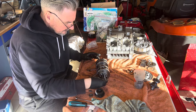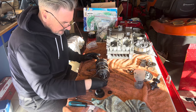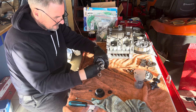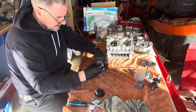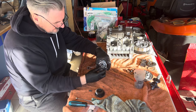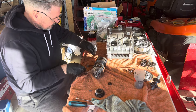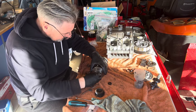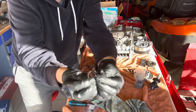Here's the new nut I brought that holds the transfer gear on the end of the crankshaft. It goes on really very easily, all the way down to the end of the threads without any problem whatsoever. Whereas the old original one won't go on at all — it just goes on a few threads and then starts to bind up. Whether that was damaged in getting it off, like I said in the previous RD video it was really really tight and I didn't want to chance it and break the crank — the new one seems to have done the trick. Now picking out the old o-ring that sits inside the bearing there, and once I get it in front of the camera, that has been an o-ring too long.